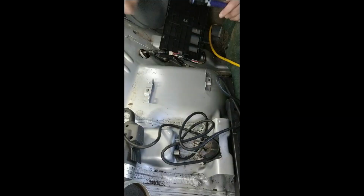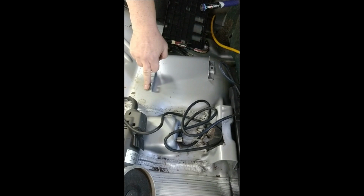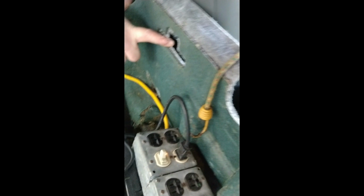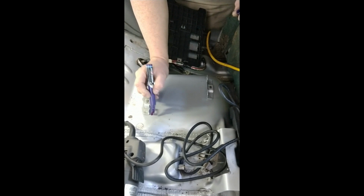All right, what we're going to do is mark off the areas where we're going to cut. This is a guess. There is a spot weld here and here, here and here on this floor. These are the attachments for the seat as well as for the rug. I'm not going to move these, however, I'm going to move this area. So we took a marker and we are going to mark off the perimeters of our cut here